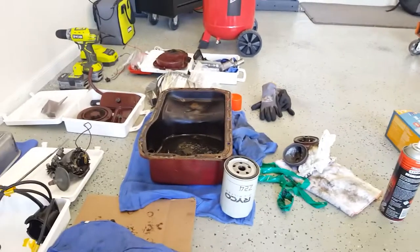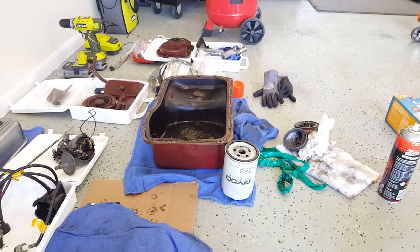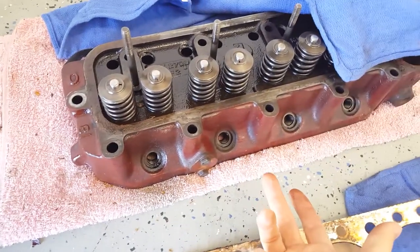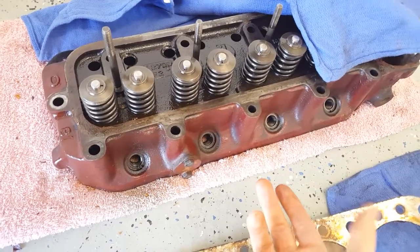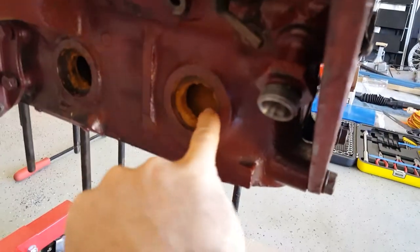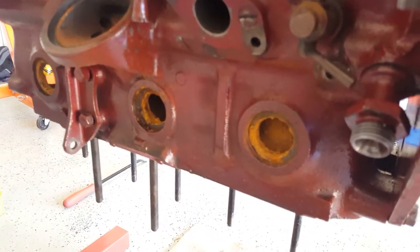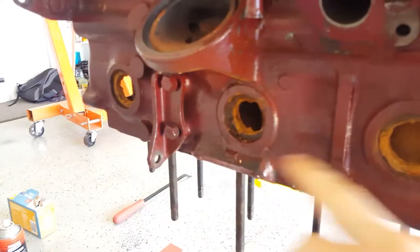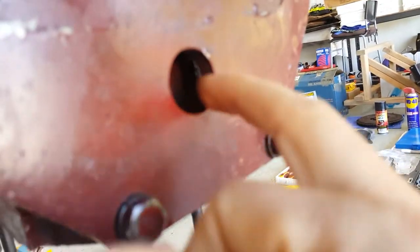However, with those little bits of gunginess in the oil pan and that slight pitting on the middle journal, I turned my attention to the head - and sure enough, there's a blown head gasket. The valve springs and everything look nice, but underneath there are different sized valves - it's been upgraded for racing. There's a lot of crud in the water jacket. I've punched out the core plugs - if anyone's doing this and replacing everything, they're not expensive at all. You basically drill into it, make a hole and lever it out with a screwdriver. There are three core plugs along the side - the engine is obviously upside down - and there's a fourth one in behind here which to properly access you'll have to remove the faceplate. If you go to the MGA Guru site there is a way of doing it with a bolt threaded in - you can apparently even do it with the engine still in the car.